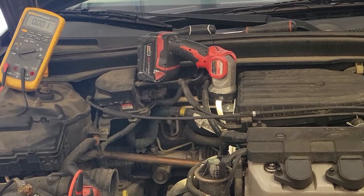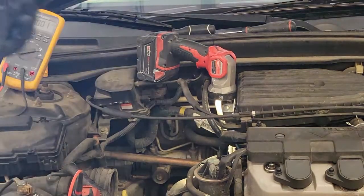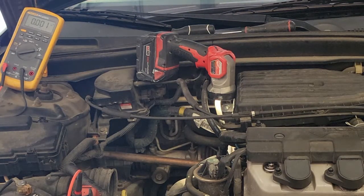At this point it's either an intermittent problem or the pressure switch is physically stuck, if the valve is actually moving. The only way the computer can diagnose this issue is if the pressure switch doesn't change state and the line going to the solenoid is open. Right now it's not, so I'm probably going to clear the code and go drive it to see if I can get it to come back on. We'll just have to replace the valve assembly for that oil leak anyway, so I think we're just going to have to replace it. But I'm going to clear the code and go drive it.